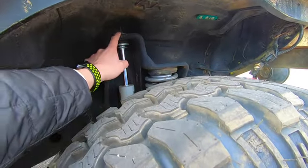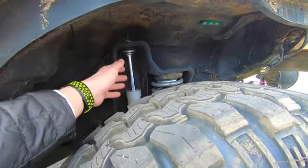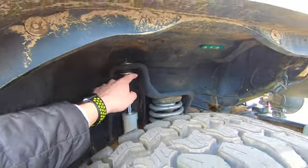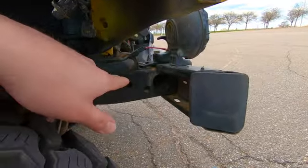You look and see on your strut mounts to see if your shock mounts or your shock towers are starting to deteriorate, or if the top hat over here is rusted, or if the rubber inside here is starting to go. And you can even check out the back of your bumper and the front of your frame.